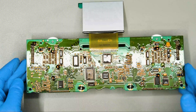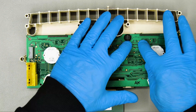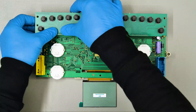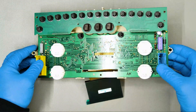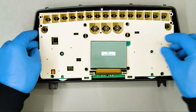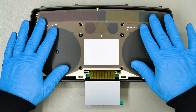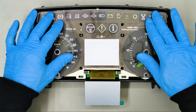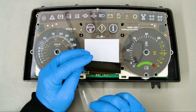Making sure not to damage the new display, reattach the two boards on the plastic base. Put back the rear cover and the overlay with its protector. Peel off the protective films and lay the LCD.